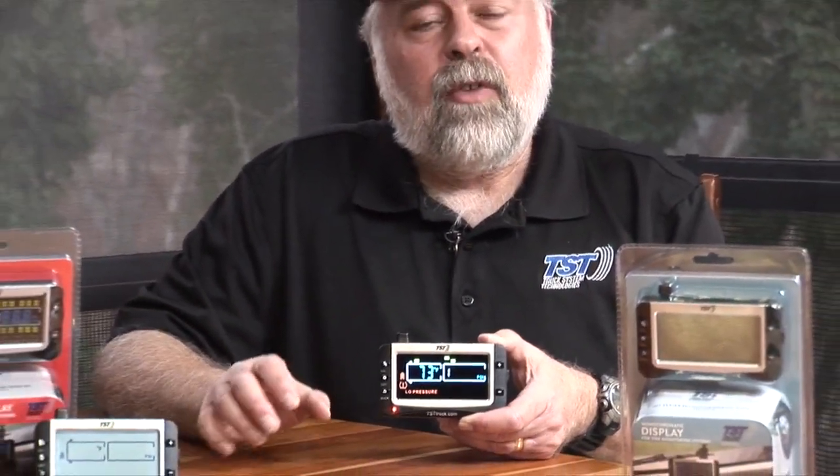Okay, now it does have an indicator on here for your sensor battery as well. The only thing about that is if you have the monitor shut off and the sensor is actually failing or dying because the battery is low, then you may miss that symbol because it's only available for about 2 to 3 days, because the battery at the very end of its life in the sensor will throw out a signal that says change the battery, and that's another indicator that's on this side at the top of the screen. So you may or may not see that.